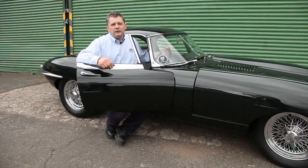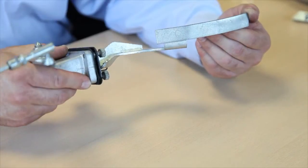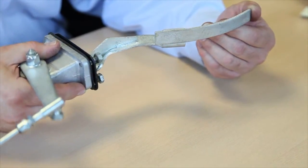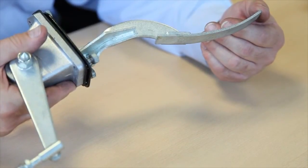The linkage ball-ended joints and lever swivel trees have substantial lost motion even when new. Additionally, the original pedal arm is quite flimsy and has only minimal adjustment range, which for taller drivers gives a cramped driving position and restricts heeling and toeing.